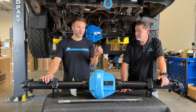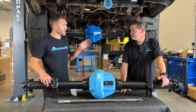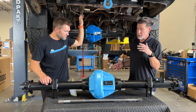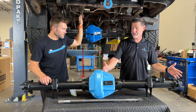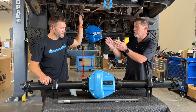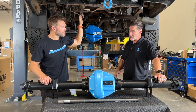These vans are incredibly capable if you put them in two wheel drive and then lock the locker. So when to lock that locker? Do we just drive around on pavement with the locker locked? Absolutely not. Typically in a van like this, you're probably going to use it when you get into really uneven conditions — maybe going through a big rut where one tire is going to lift off and just spin. The way a differential works is it drives power to whichever wheel spins easiest, so that's the one that will break loose. When we turn on our locker, it's like a spool — both wheels turn exactly the same speed. So if you get into a rut and one tire lifts up, you lock the locker, all that weight's on that one tire, it gets great traction and pulls you through. Same in mud, sand, or if you stop on the side of the road with one tire on the highway and one in the sand — put that locker on and it pulls you forward.